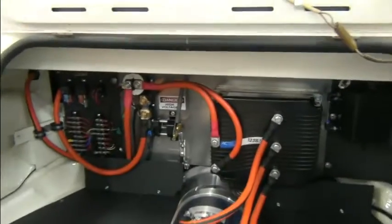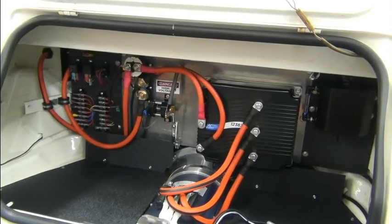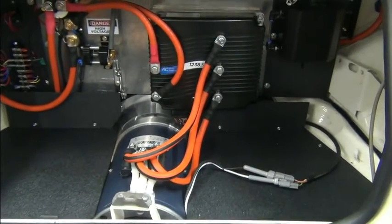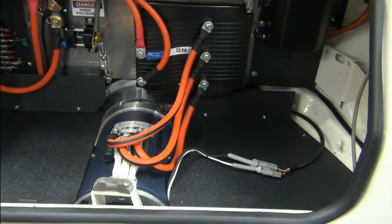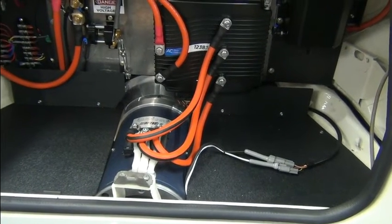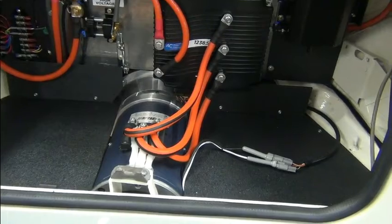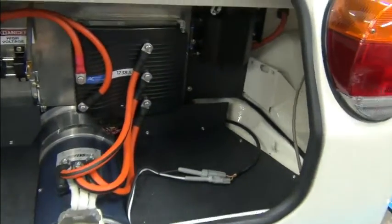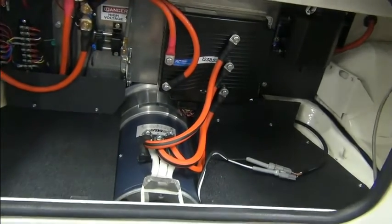Let's take a look at the engine bay. The last time we had run the 12 volt wiring and the control wiring. This is not the motor that will go in there — we just use it as a place holder. That motor is actually the one out of our sand rail; it just happens to be an AC50 also, so it's a good place holder. We were waiting on the flywheels. The motor is in there just as a place holder, connected to the adapter with no coupler, no flywheel, no clutch. It's just in here to allow us to do the fitment of our panels and the lengths of the cabling, only being held on with the two top bolts.